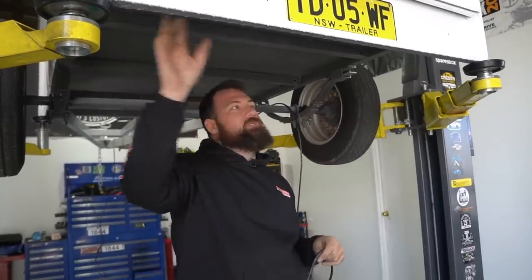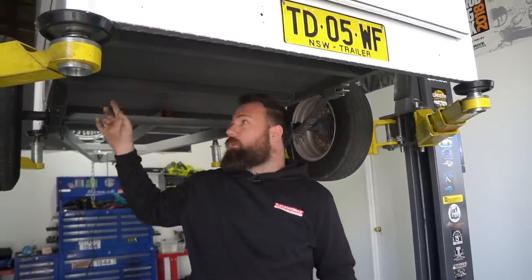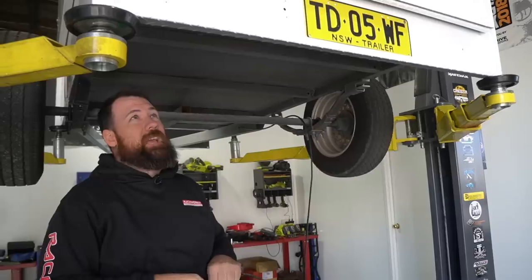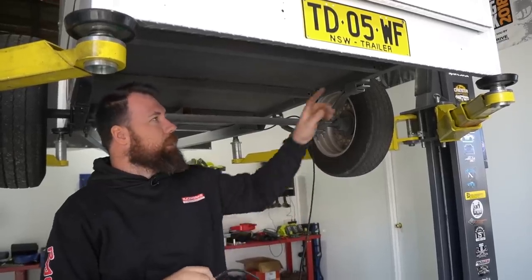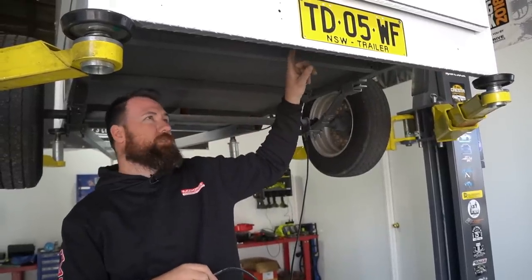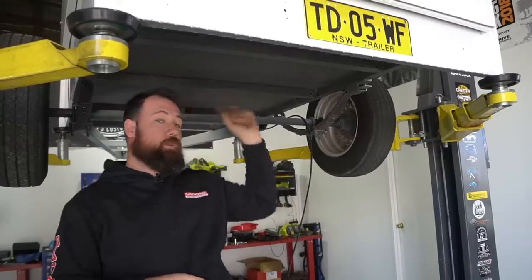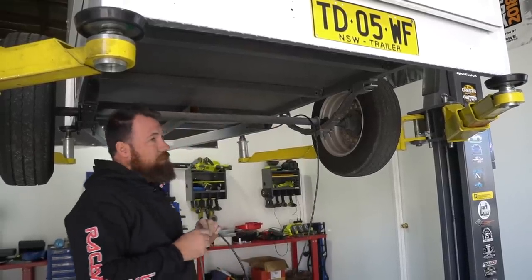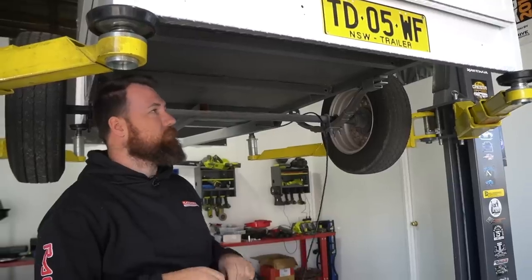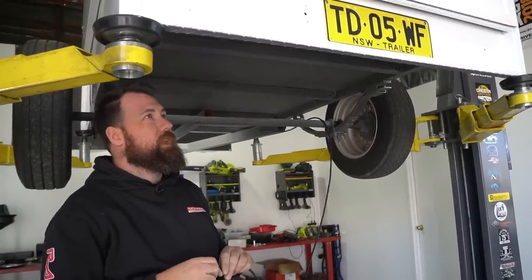So basically we've got the two taillights, the number plate light, and we've also got four marker lights that we're gonna put up on the top edge of the trailer. I'm not exactly sure how we're gonna cable that stuff up yet. We'll most likely run it through this back corner and up the rear corner of the trailer. Then we'll run forward and then we'll run across and forward to power all the lights. They're all LEDs, so should be pretty neat, and there's basically zero current draw compared to if they're all incandescent bulbs, so should be nice and simple, and we'll keep wiring away.